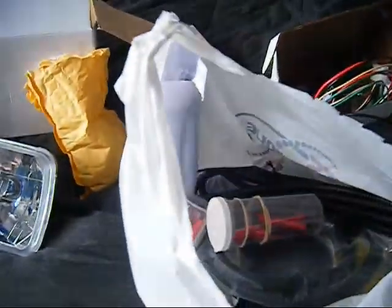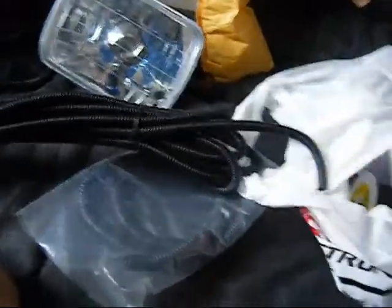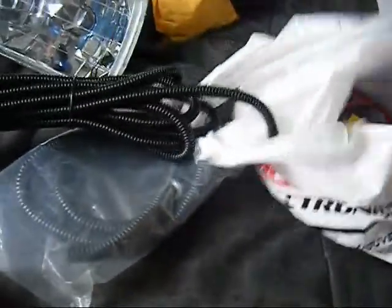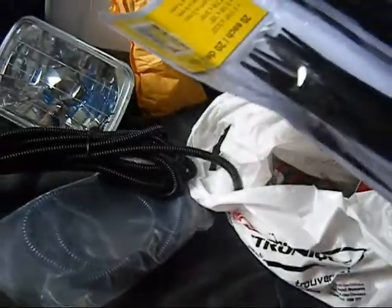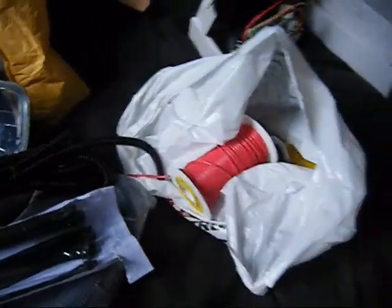To make the wiring harness was fun. I'll show you the paperwork if I knew where the hell I put it. But you can buy all this stuff at an electronics store. I got 3/8 inch split cable wrap, 1/4 inch, lots of heat shrink tube. I've just cut it down and stacked it in here. I got lots of cable ties. Lots of wiring. This stuff's 18 gauge. You have to check the wiring chart.